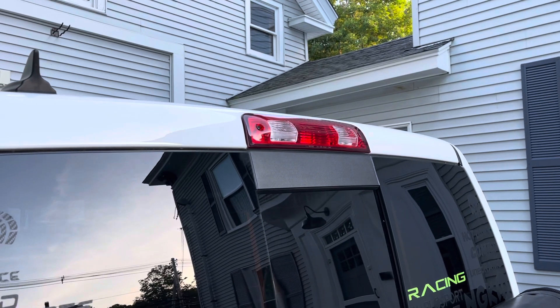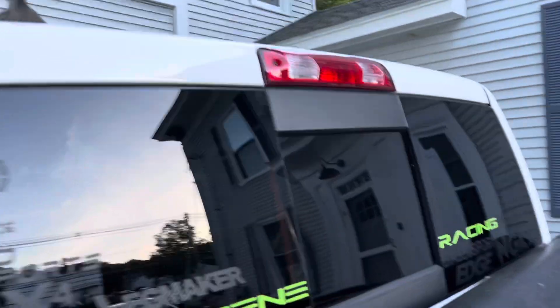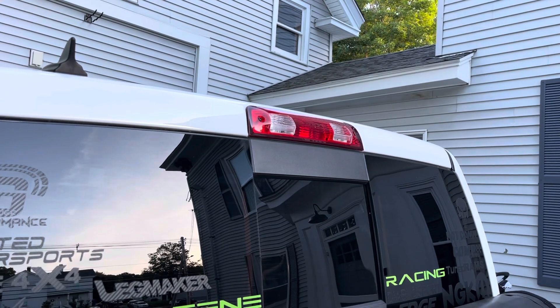It was a brain fart I had — I do a lot of windows and doors in my jobs and I thought this stuff's gotta work on my truck, and it did. I'll leave the link in the description for the original video from 10 months ago. It is a permanent fix. Zip tape is your best friend, especially when you have a leak in the third brake light. It's flashing tape — put your first piece down the bottom, then overlap each piece at least an inch and a half. Put three, four, even five pieces in there if you want, as long as it doesn't leak. Don't go top-down because water will come in again.